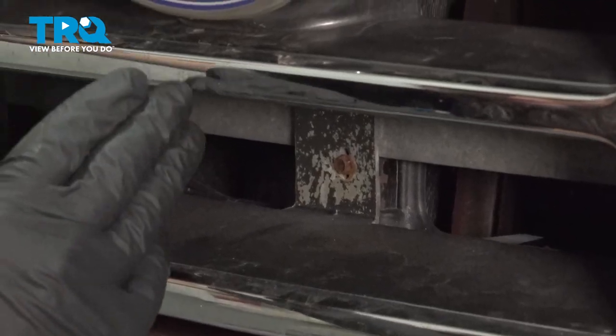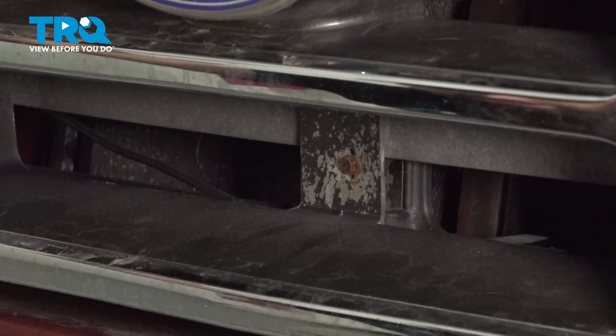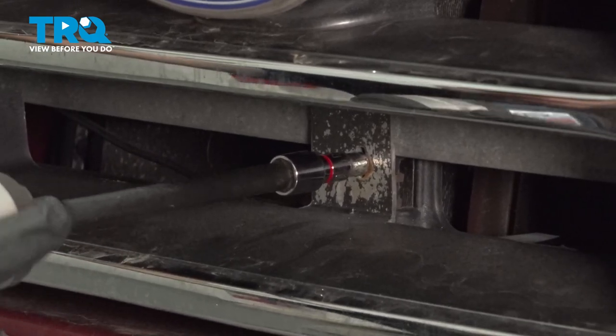So now, again, directly under your Ford emblem, right in here in the center of this vent, you'll see one more screw. Ours isn't factory — ours is a quarter-inch. You should go ahead and remove that now.